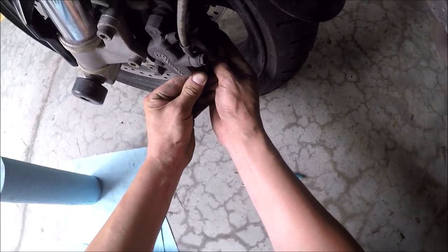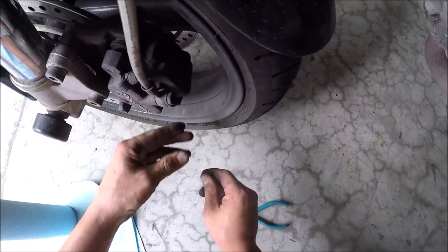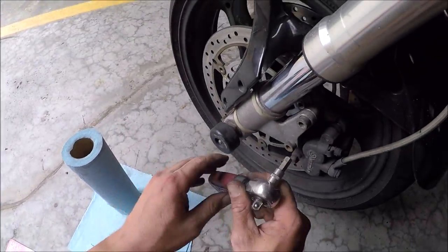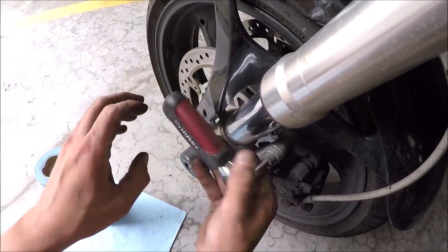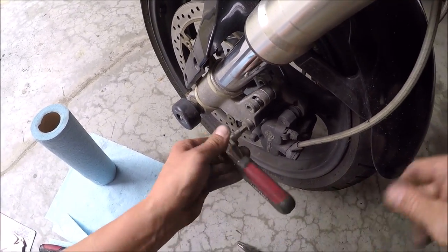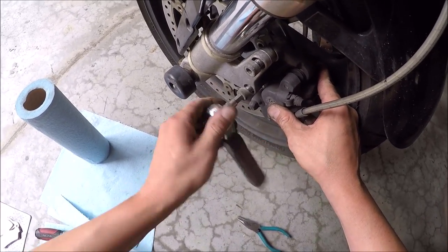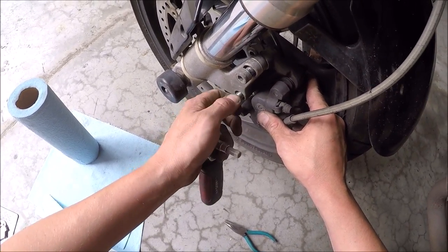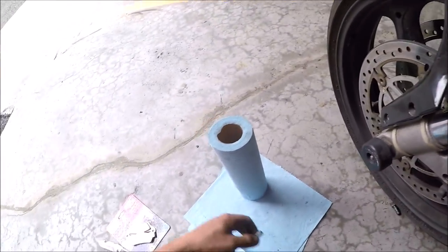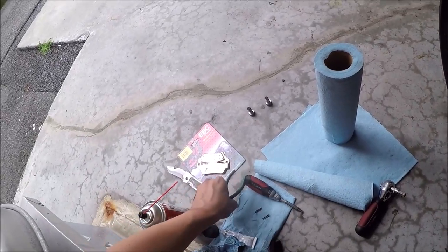These are your pins that hold your brake pads. See, I pushed it a little bit — that's good. So now what we do is we remove the caliper completely so we can take a look and pull out those brake pads. I'm going to put them over here, out of the way, since we don't need them for now.